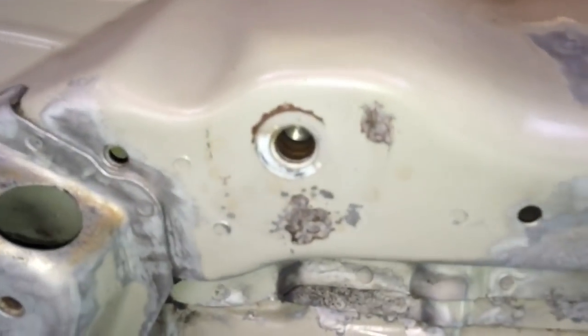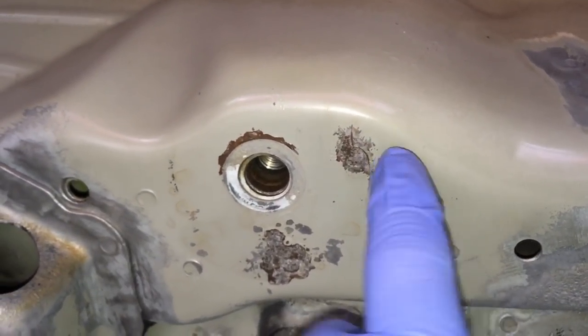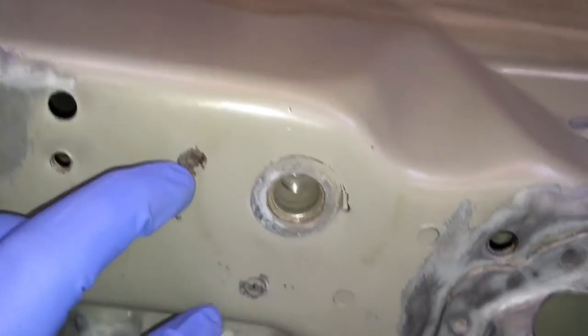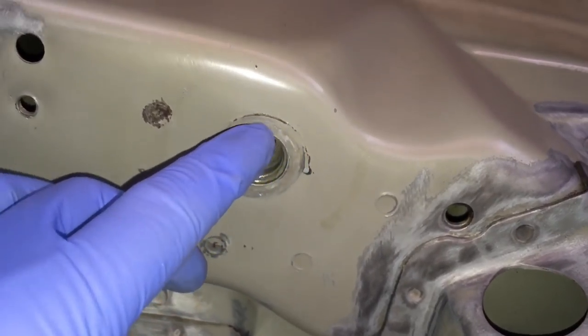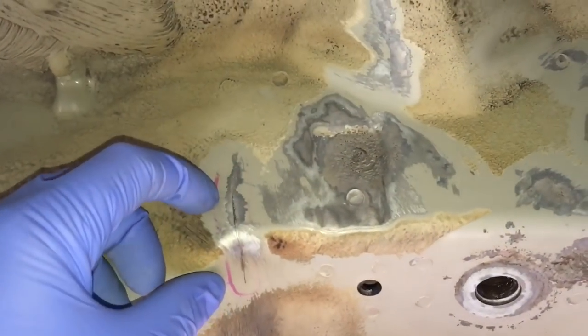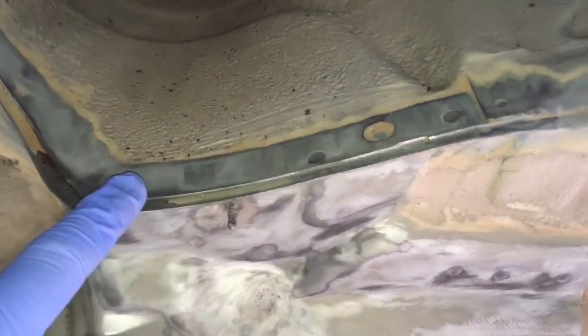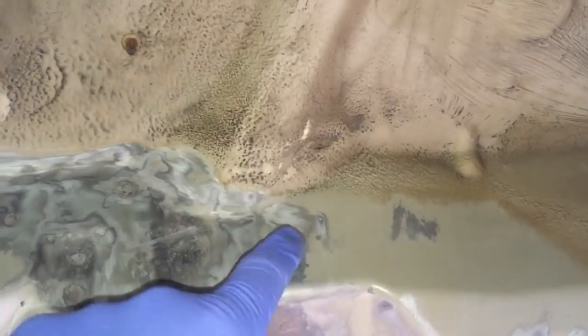Now we can actually start on the crack work. You can see a hairline crack coming around that spot weld there — another one there where it's broken the paint and gone rusty — a couple of spot welds which are flexing. We know we've got both of them cracked inside up behind there, so we need to go inside the car underneath the seat panel. There's that typical crack on the left rear mounting point, broken spot welds down that side we need to do, plus a little bit of a drop here — we need to get a bit more seam sealer out and stitch weld all that together carefully. Also check the chassis leg spot welds to make sure none of them are broken.